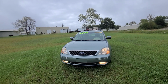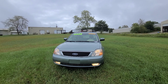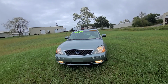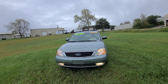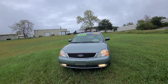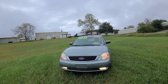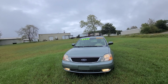It's a 2005 model. It's a great car and I've done a lot of repairs on that. So basically I replaced engine mounts, engine torque mount, EGR valve, fuel pressure sensor, new spark plugs, new ignition coils, new intake manifold, new intake manifold gaskets, new air filter, new fuel filter, new sway bar links, left and right side, new shock struts and coil springs assembly, both sides, right and left.